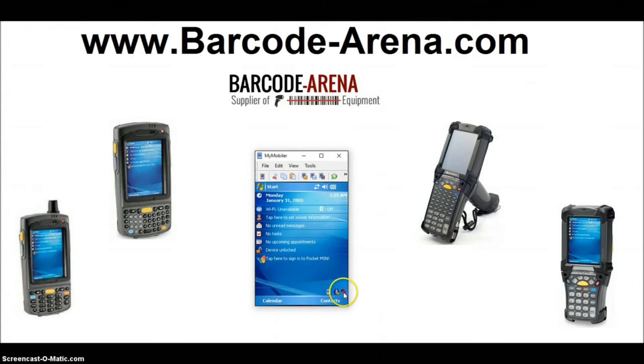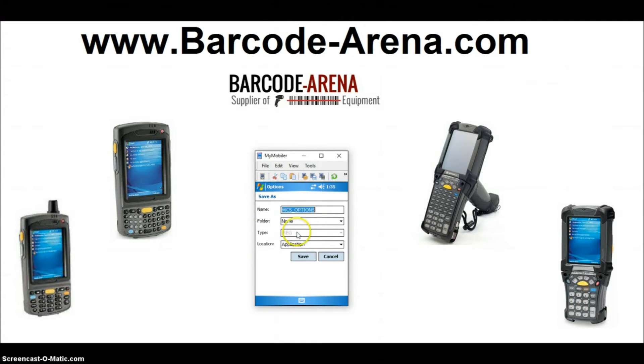This is your Wi-Fi radio icon with the X over it — your home base for managing everything Wi-Fi. Click that, open the Options drop-down, click Regulatory, and uncheck that box — always turn it off, as most networks won't allow you to log on with that enabled. Under Band Selection right underneath Regulatory, turn on 5GHz so you've got both networks available.